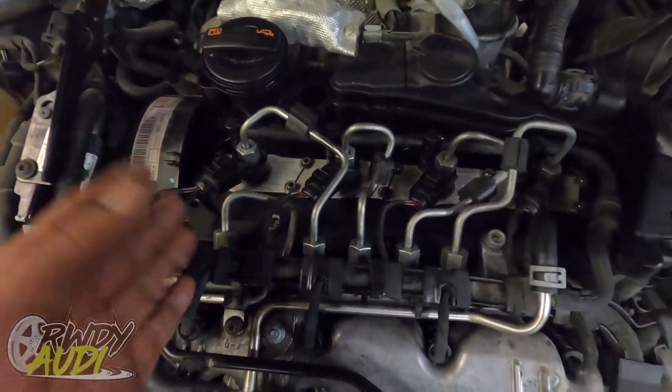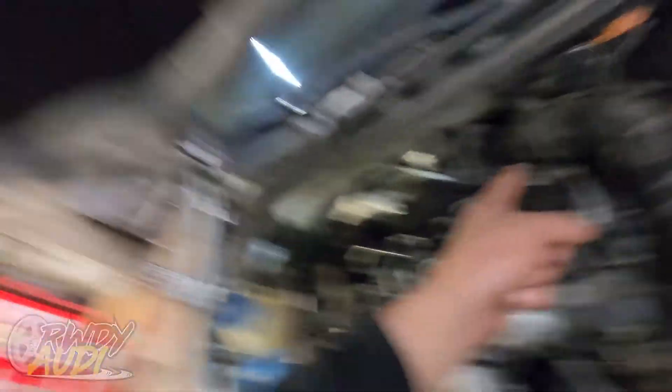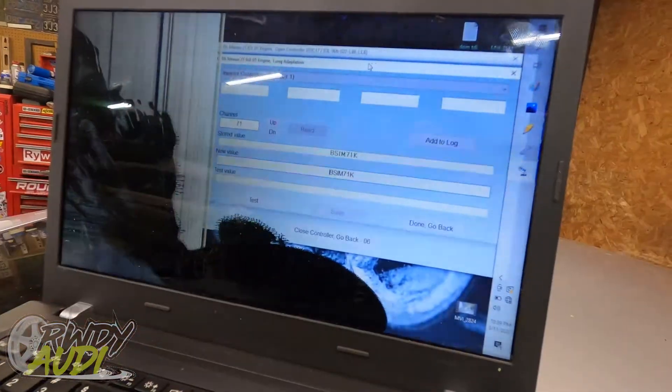If you didn't replace your fuel injectors and you're replacing your motor or for whatever other reason you need to code your injectors, just take them off in the cylinder order that they're in. The way the ECM in the car recognizes the injectors is: this is cylinder 1, 2, 3, and 4. So if you're programming them from a new engine, that's the order that you need to know them in. Let's get the first injector programmed and then we can move on to the next step.